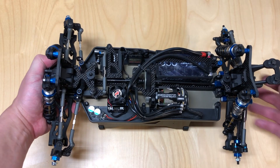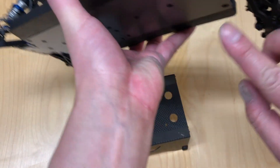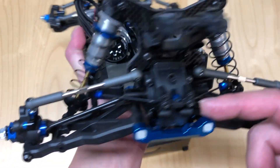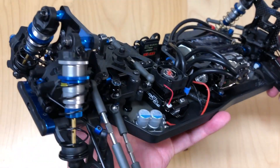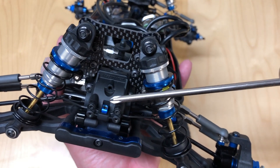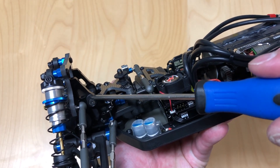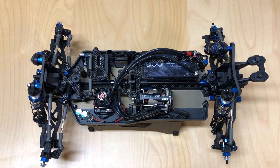Some other nice features: the diffs are once again very easy to get to. They changed it slightly — you basically have to remove two screws up top, one underneath in this little hole here, and then one on each side, which are these aluminum braces that hold the diff in place. It also has adjustable axle heights. I'm not sure if any other four-wheel drive buggy on the market has that. It uses these black aluminum braces on each side that hold the diff in the middle, and then you've got inserts which you can use to adjust the diff height. I'm in the lowest position, but there are different inserts to raise or lower that diff — pretty neat feature, and they basically solved the problem of adjustable diff heights.